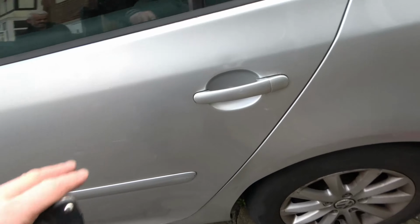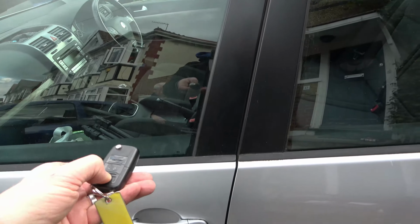As well as that, if you look at the windows, when I hold down the unlock button, you will see that the windows here will come down, and also the other windows will come down, but yet this window is not working. So on this door here, the speaker works, but the door lock's not working and the windows are not working. Now, a lot of the time people will think it's a problem with the door lock, but it's not. It's an actual module inside